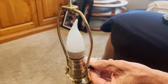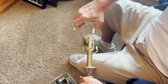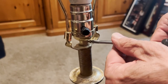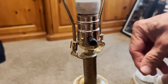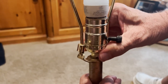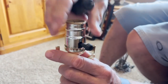The next thing we're going to do is remove this little bracket — just compress it and pull it out. You'll need a Phillips screwdriver. We're just going to undo this screw, and that should enable us to look at the inside. One thing you always want to do whenever you're working with electricity is make sure it's not hooked up to the outlet, so make sure you unplug it.